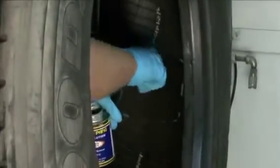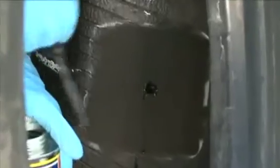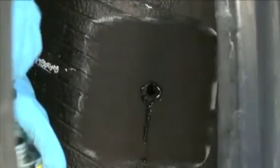Cement the injury from inside the tire using Truflex Pang 608F Super Solution and a spiral cement tool with a clockwise rotation. This procedure should be repeated 3 to 5 times depending on the thickness of the tire. It's important to leave the cement tool in the injury as you proceed to the next step.